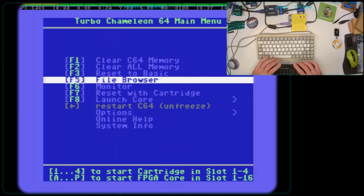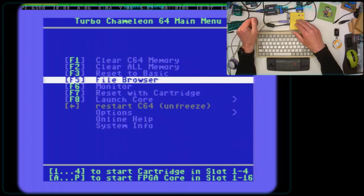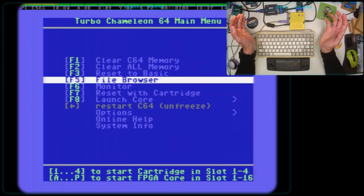We see some progress on the Turbo Chameleon version 2 topic, and that's really nice. I'm really happy that this development is improving and that all those things are working fine, especially that the standalone mode is really useful on a standard setup. It requires the VGA connection, and if you have an HDMI setup it requires an HDMI converter, but they are kind of cheap. I tested a couple of different resolutions and found that the standard 640x480 works best. The others have some issues with aspect ratio, but 640x480 is really okay.